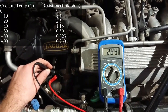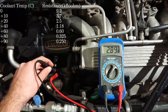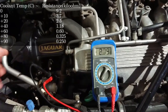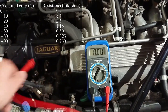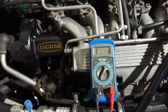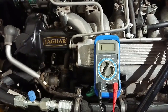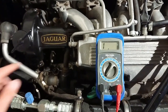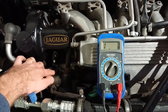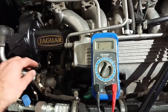At the moment it's a cold, chilly day — about 17 degrees in here — so that is completely fine. You can use an infrared thermometer to measure the exact engine temperature, because maybe your engine runs fine at idle but once it gets up to temperature it runs a bit weird. I actually had that issue — this sensor was correct when cold, but when the engine was at running temperature it was not correct, and therefore I changed it out.